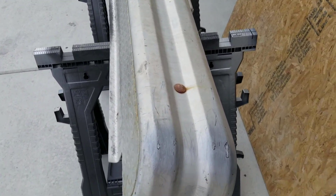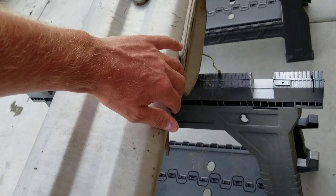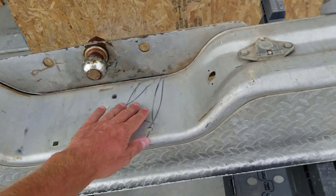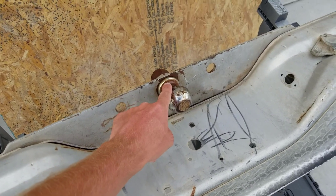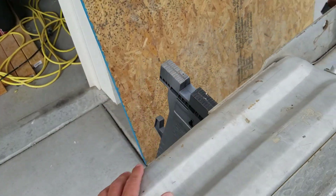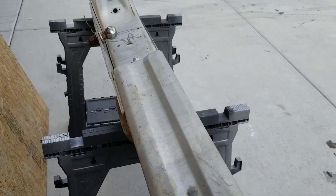I'm going to scuff down the bumper. I'll only paint the main face and the under lip, and then the step I'm going to do with bed liner. I put some PB blaster on the ball so hopefully we can get that off — I may bed liner that part as well. I got some Rust-Oleum chrome paint. I did a little research and supposedly it's a good product — you just have to let it cure for five to seven days so it can really harden up. I'm going to sand it with 180 grit, move to finer sandpaper, and then we'll paint it.